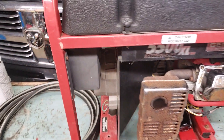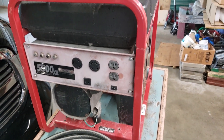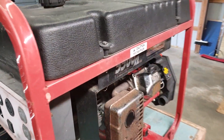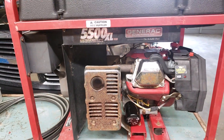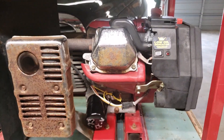This is basically what happens with bad gas. In this case, the fuel stabilizer really messed up the carburetor. I used to use Blue Streak fuel stabilizer, but I don't anymore — I find it's way better to just not have gas sitting in equipment. Most fuel stabilizers don't work anyway.